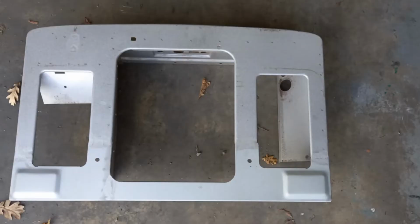Because we intend having this piece galvanized, the galvanizing companies always ask that you bring a piece to be done shot blasted immaculately clean, and that's because before they put this in the 400-degree zinc before they dip it in, they actually put it in acid first. And even after a shot blasting, you can see places on here where there's little bits of rust and just little things that the blasting hasn't quite got off. Now, the purpose of the acid is to clean all of this off and greasy fingerprints and anything else that might be in there before it goes into the zinc.